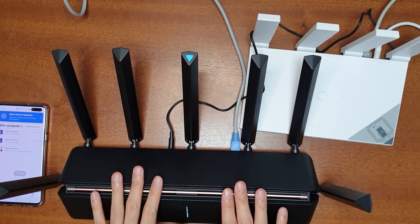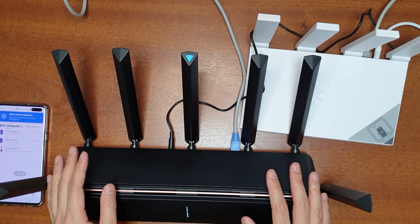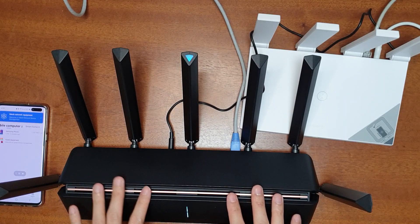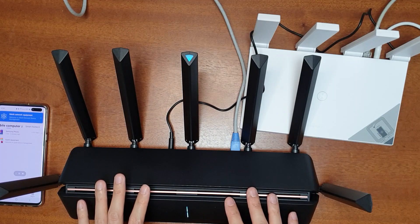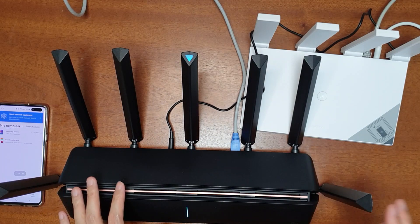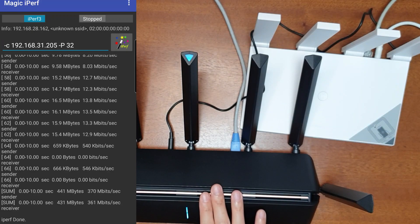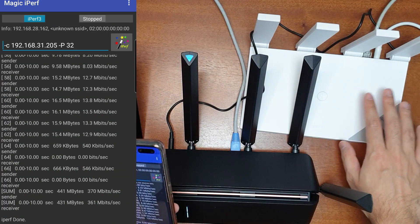For the comparison between the AX3600 and the AX3 Pro, I won't use an internet speed test because it's not a reliable or objective method. Instead I'll use a program called iPerf, which measures network speed — wireless or wired — between a connected device and the router. I'll test at different locations in my house and show speed comparisons. Using the iPerf mobile app, I'll connect my phone to each router wirelessly, connect the server to each router, run the test, and present a comparison result.